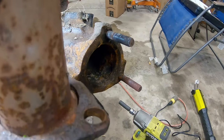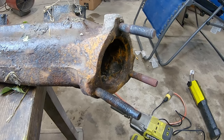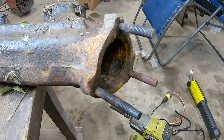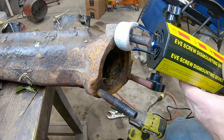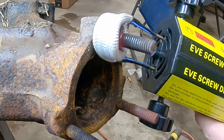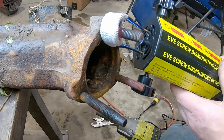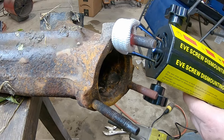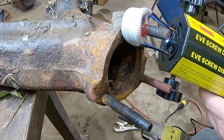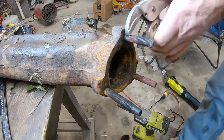The exhaust pipe's not even hot — like I can hold it now. For one of the studs, I think we'll heat it and lock some vice grips on it and see if it comes off. I don't have a stud tool that size. Let's heat the stud the same way we did the nut and then lock the vice grips on it and turn it out. If you're at all like me, you've probably broken more of these than you care to remember, especially when I was younger working underneath cars — small block Chevy. Now the idea would be to heat the manifold and not the stud. I don't think that's an option with this fitting we have in here. It's pretty hot — let's see if it'll turn out. We'll lock the vice grips on it.